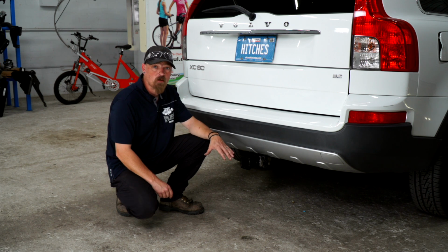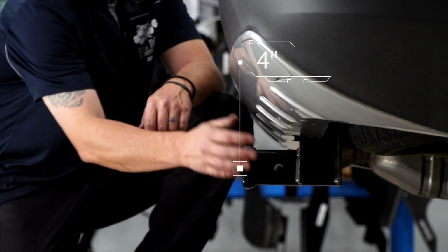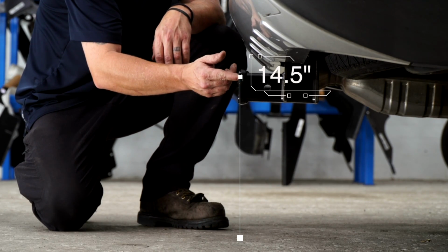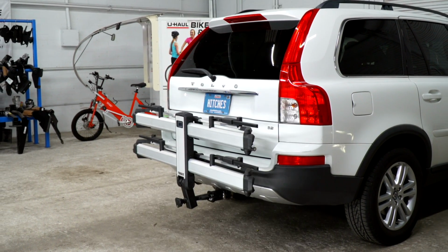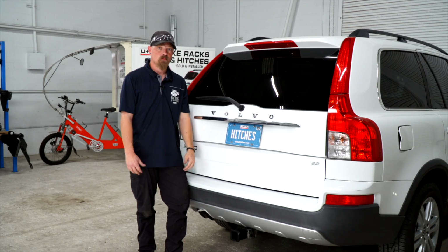Now that we've finished installing our hitch, we pulled it down to level ground so we can get some important measurements for you. This is a 2-inch hitch receiver. From the pinhole to the end of the bumper is 4 inches. From the ground to the top of the receiver is 14.5 inches. This will help you determine the length, rise, and drop for your hitch and hitch accessories such as a bike rack and cargo carrier. Thanks for watching our video.